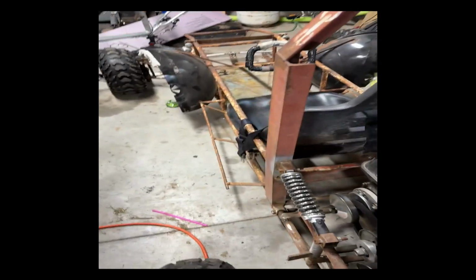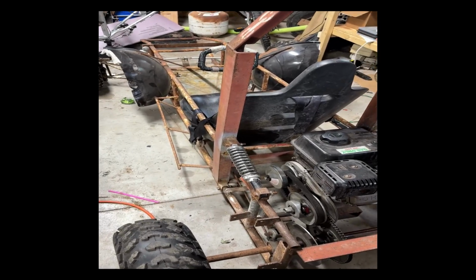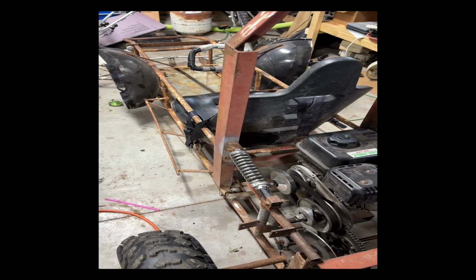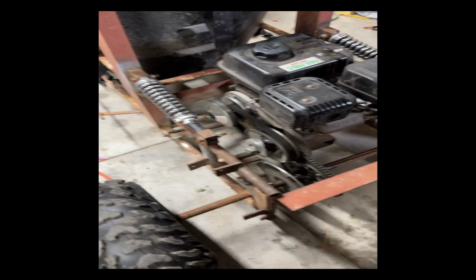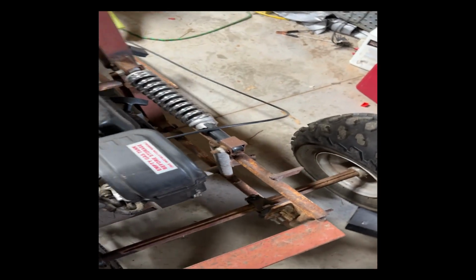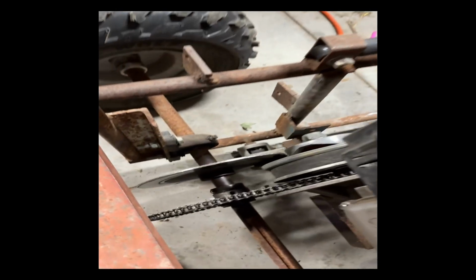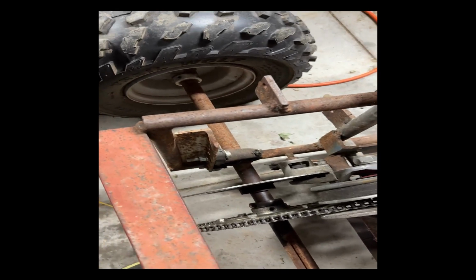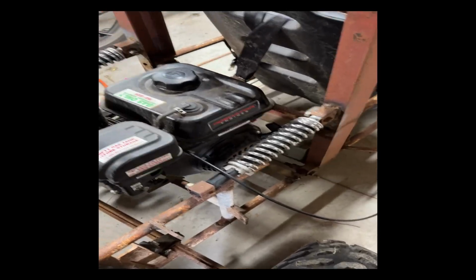My grandparents had this granary that they're about to take down. There was this frame sitting in the barn, probably since the 80s. So then we welded up this frame, put a motor in it and a sprocket CVT drive in it. Had to make some brake mounts for it, that brake setup. Suspension mounts, fabricated it. It's got some shocks here, this roll cage.